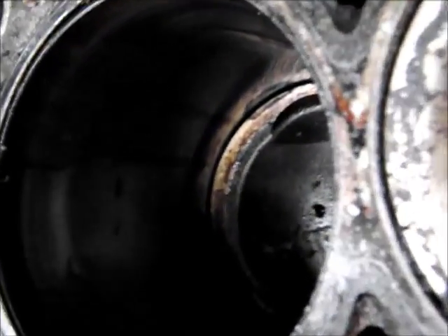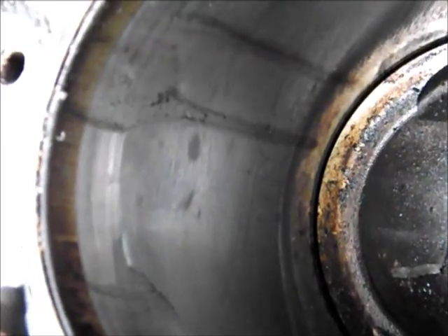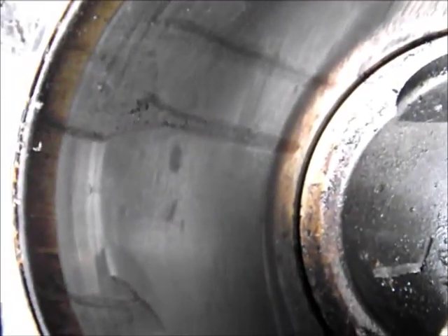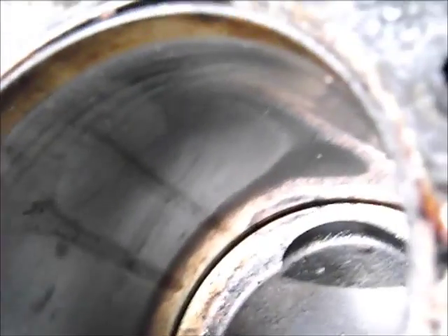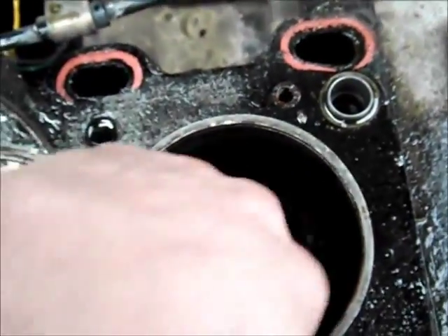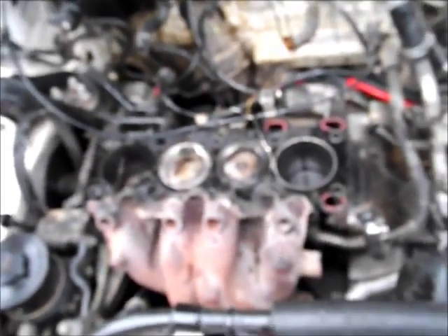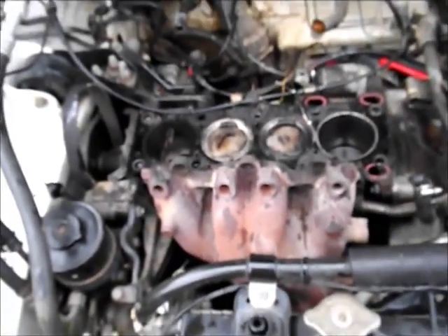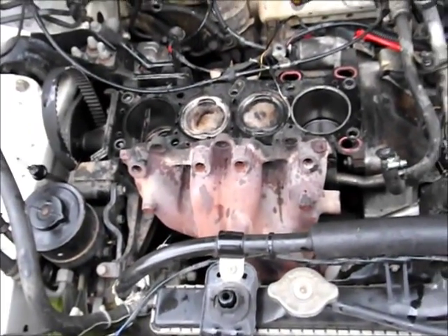There's another really interesting thing to note over at the motor. You can just see very slight cross-hatching still on the cylinder bores — and that's impressive because this engine's done nearly 300,000 Ks. You can sort of just make it out — very, very light cross-hatching still left in the cylinders. This is a 270,000 K engine, it's a 1.6 litre, it's gutless as hell. I dumped some petrol down number 4 cylinder and it hasn't gone down, so these piston rings and cylinders are actually in fairly good condition.